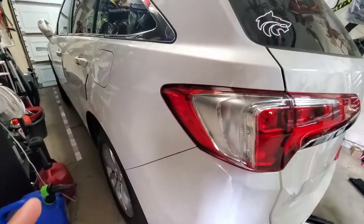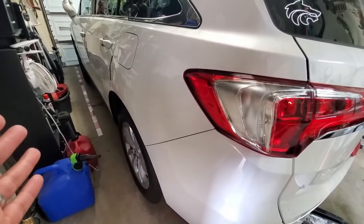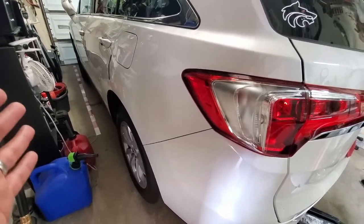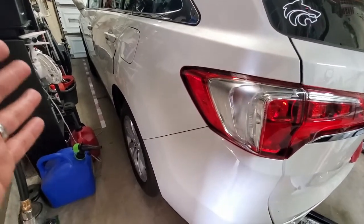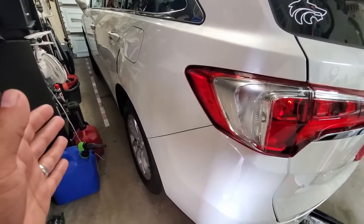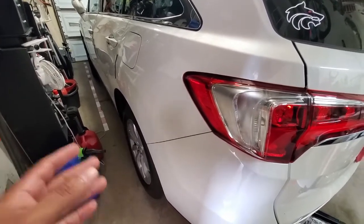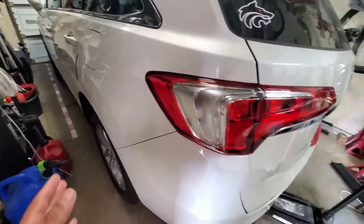In my experience, semi-metallic pads tend to be noisier. There are a bunch of other pluses around ceramic pads, but the big one for me as an average joe is that they're quieter. We're going to get those swapped out. I'll also talk a bit about swapping brake pads in general, because brake shops charge a couple hundred bucks and I want to cover what you can do yourself versus what you should take to the shop.